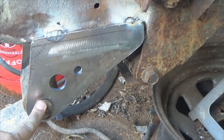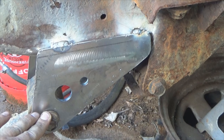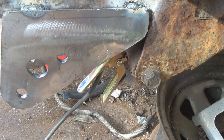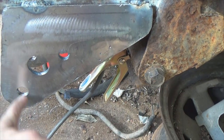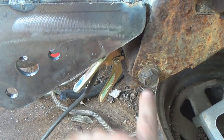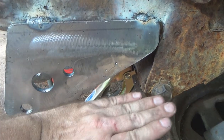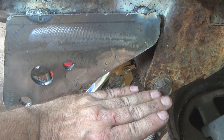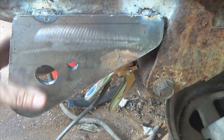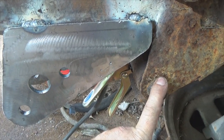Spring height — yeah, not quite as critical, but you still want to get as accurate as possible. So what are we gonna do? Here's what my intentions were: I was gonna take that bolt out, pull the bushing out, have one bolt go all the way through here and another all the way through here, then weld me a piece of metal from bolt head to bolt head to make me a jig. Slide it in here, slide in here — that would give me my proper spacing. All I'd have to do is get my angle finders, drop on top, match my angle, make sure it's level.